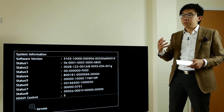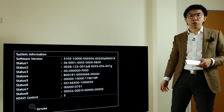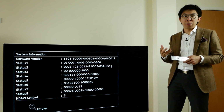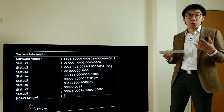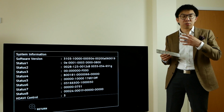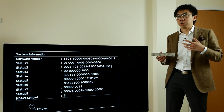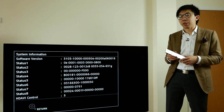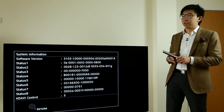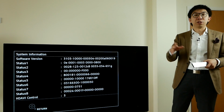After this TV has accumulated 4 hours of usage time, it will automatically trigger a compensation cycle upon standby. And how do we know this? We know this by looking at our wattage meter. Once you go into standby, it will still use around 45 watts of power. We took an insane amount of screenshots to find this out, and no one actually told us this, so I'm giving the secret away.